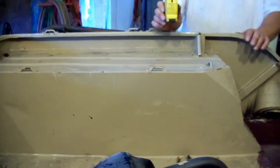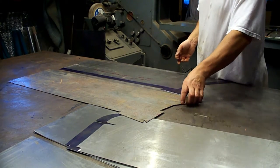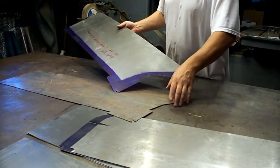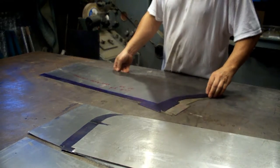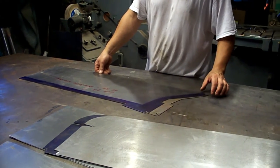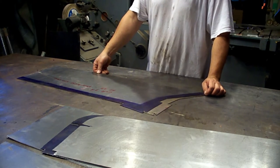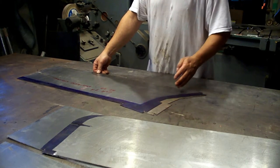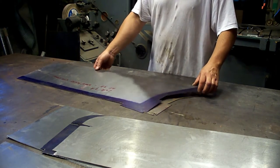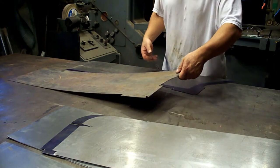Here's the intersection of the wheelhouse — this one's from a CJ 2A, and this is what they used on some of the later 3As and all the 3Bs. You can see the difference in the bends. This section here allowed the seat to move back, and for tall guys they felt a little better in there. Sometimes when I'm doing custom wheelhouses, the real big guys ask me to shorten this up — you can take quite a bit out and move the seat way back, but you just can't get into the tire. We're going to be using this pattern for the 3B body we're building.